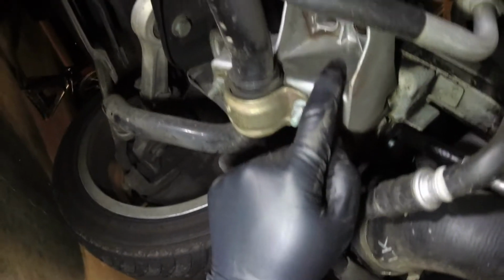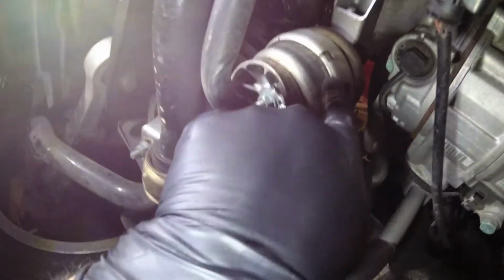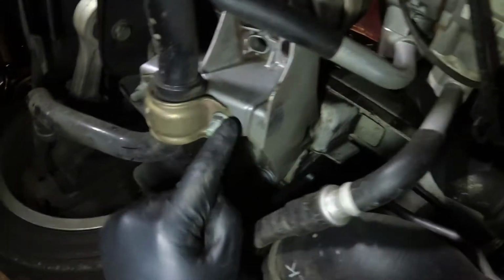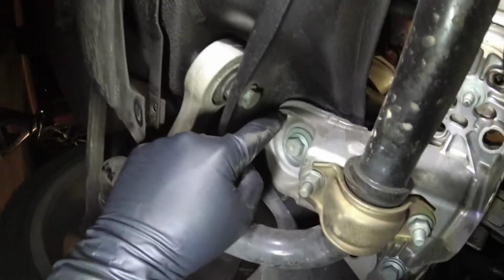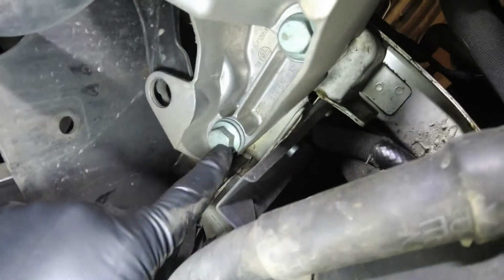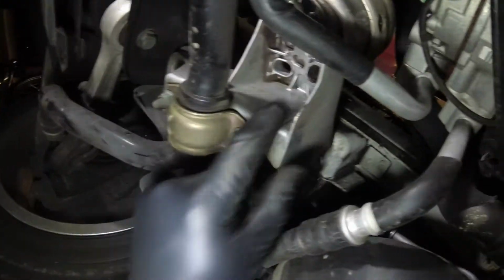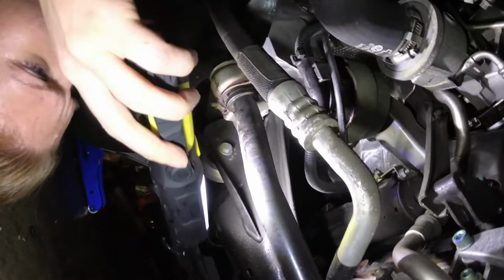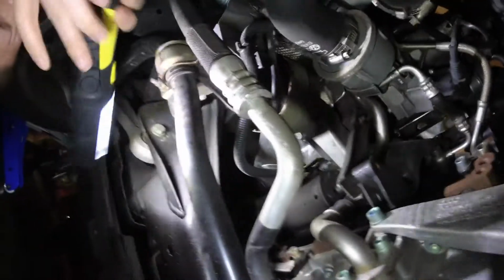That looks really new. There's this huge stamped aluminum part here on the front. It's got an engine mount on it there, and then it also holds the sway bar mounting bracket there, and then it connects to the K-member there and the frame rail there. This is a structural part of the car. It's really interesting how clean looking that is. That's unusual. I would say that one's been replaced though. I'd say that one's been replaced too. Same thing. It's really super new looking.